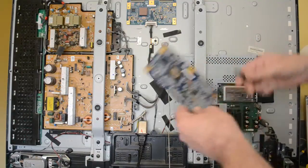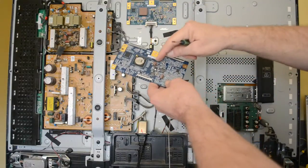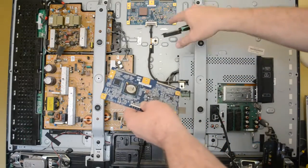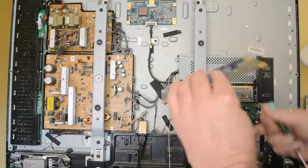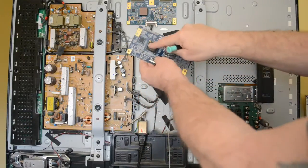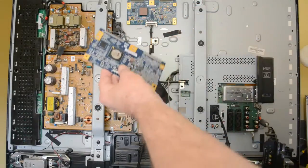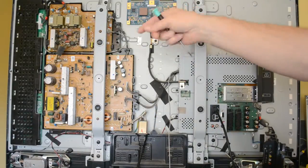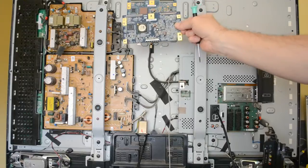Here's the old T-Con board. There's little brown pads on these ASIC chips and regulators and on the back — these actually conduct the heat to the metal panel. Someone had actually pulled this T-Con board second hand from EMOS in Derbyshire, and they've actually pulled this heatsink pad off of this chip. So it's important — replace the pads if they're missing, otherwise they'll overheat. These pads, although they're 5-6mm thick, conduct the heat to the metal casing, and same on the back.